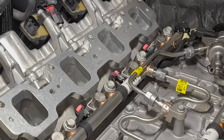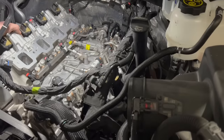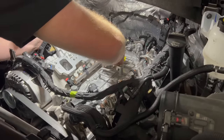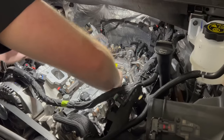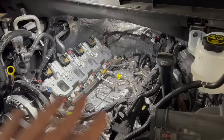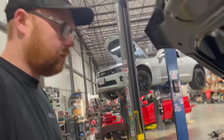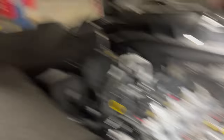When it's sitting on the engine, you can bolt the intake down just like it was before. It does space it up a little taller, but we've found it doesn't really change a lot of the geometry on the front accessory drive kit, so the same belt still works. Obviously the belt works on a naturally aspirated setup. If you do an LT4 swap or going the other way — like an SS Camaro — the same belt typically works. The truck spacers are tall though — about two inches — and they do clear the alternator.